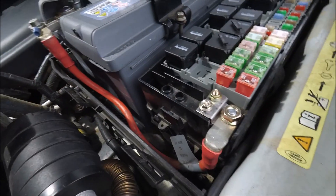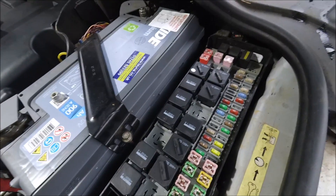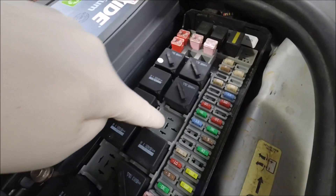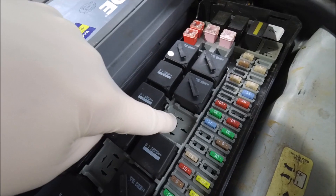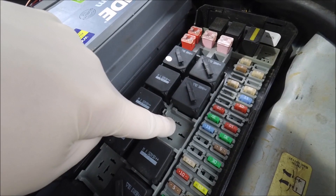The yellow wire is the ignition signal wire. You would crimp on a spade connector which goes into the relay pin here. This top relay usually isn't used in most UK cars, and that top pin becomes live when you turn the ignition on.